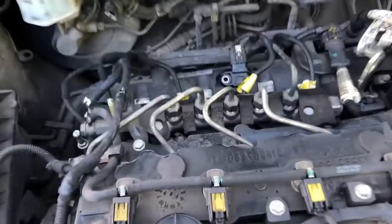So we're going to have a look. I suspect it's the MAP sensor being blocked up with carbon and gunk, so we're going to take that out, have a look at it, then look at the codes, clear them, and take it for a test drive and see if we can actually get this sorted. Let's get on with it. So this is how you take out a MAP sensor on one of these engines.